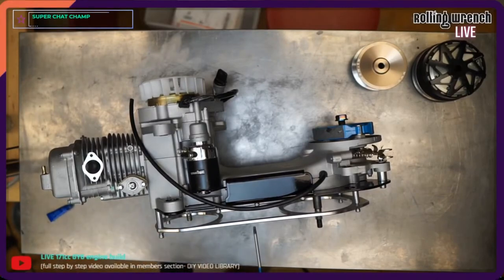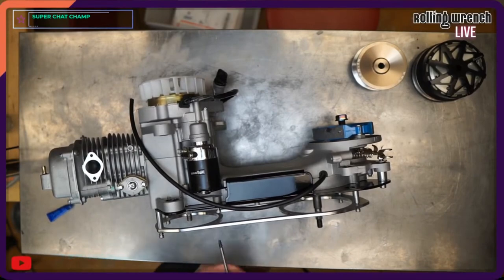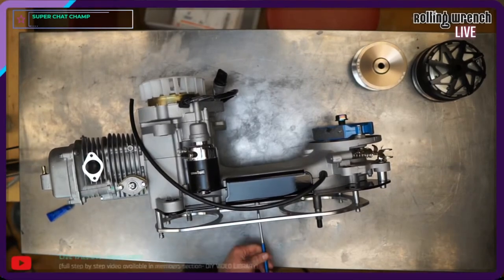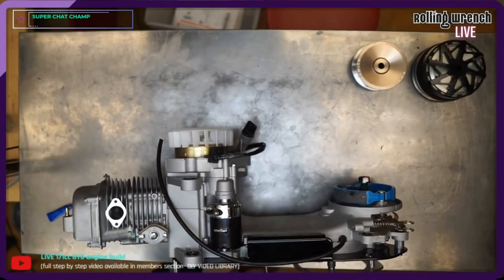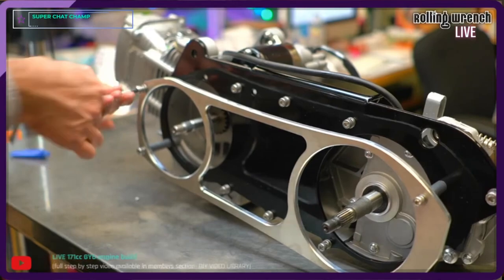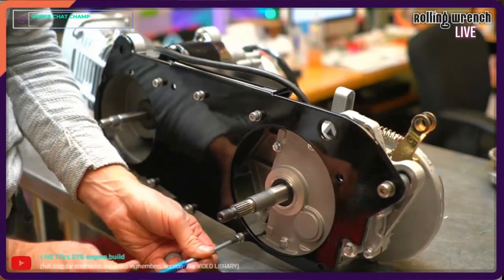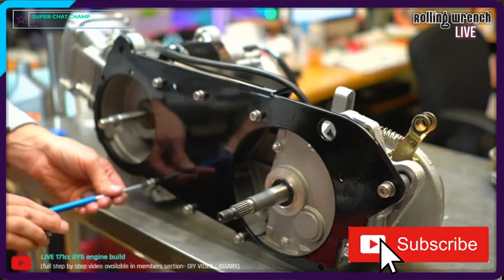So now that we know we're good, I can go through like this and tighten these back bolts down so that it doesn't move. There's no real torque setting for these. I just crank them down. I guess if there was one, you can use the 9 foot-pound torque. That's the same torque as all the case bolts, things like that. So now that I know it's tight and it's not gonna move, I'll take this little brace back off the ankle biter. I'll just crank these down, nine foot-pounds. Long story short, you don't want them coming loose.